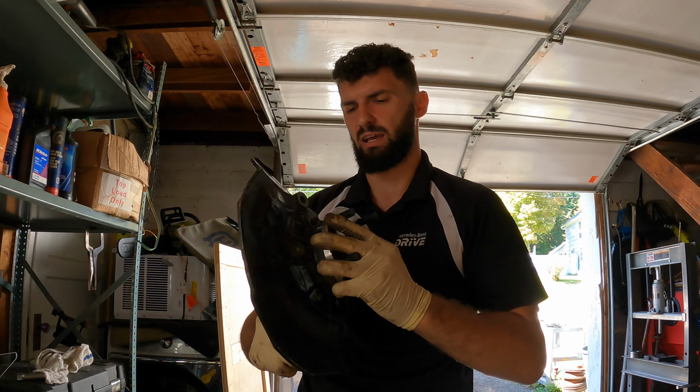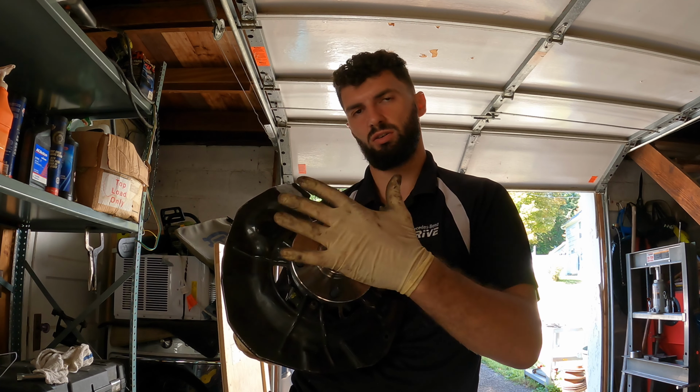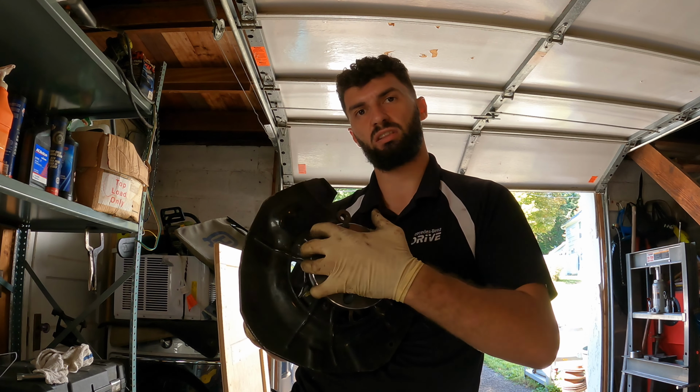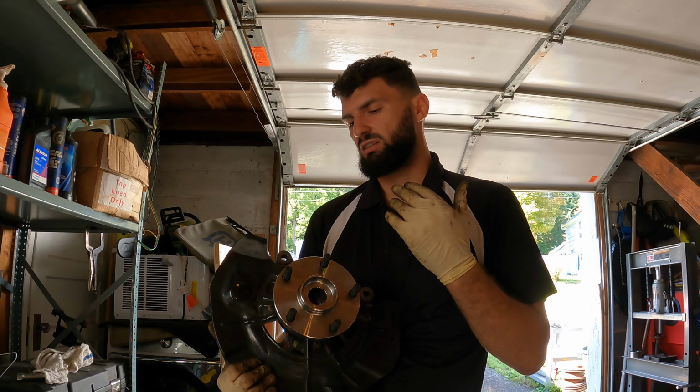the old new bearing that I installed today, that the outer lip, so the outside edge where the hub goes into first, that one was hard. Even without putting the hub in it, it wouldn't spin properly, and I followed the same steps. Also, when it was in the box, it did not have a plastic wrapper around it, so I'm wondering if it was just a defective bearing.